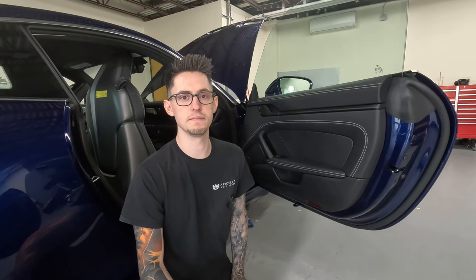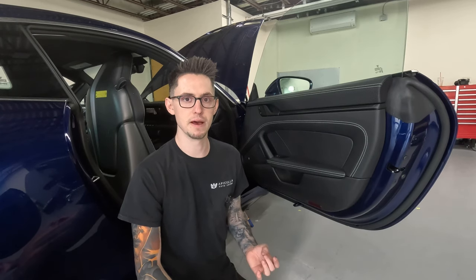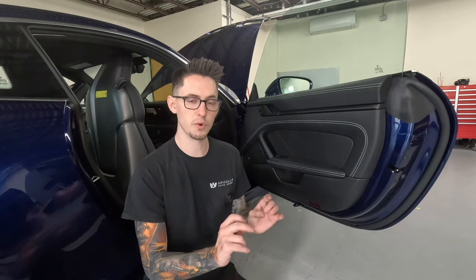For blocking and absorbing, we have our next step, which is going to be ResoNix Guardian. ResoNix Guardian is a hydrophobic melamine foam composite that has a layer of floating mass-loaded vinyl in the middle of it. That is going to be handling our sound absorption and noise blocking. That's just gonna be stuck right on top of wherever we install CLD squares.